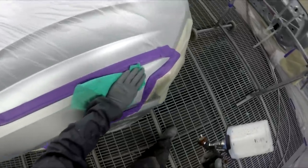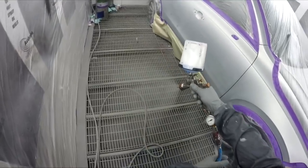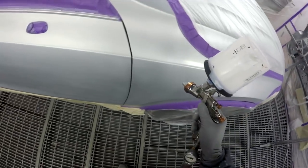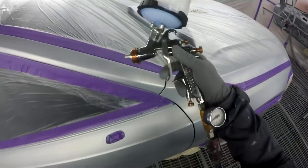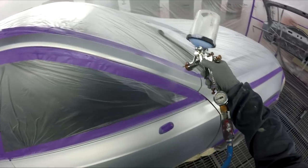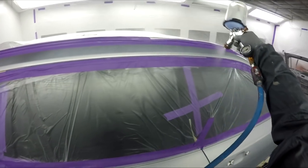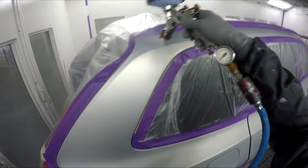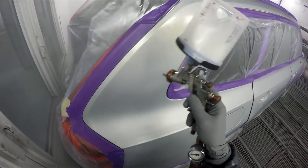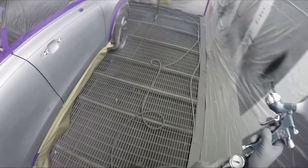So we're out to go now - I've got some slow, this is colour blender here. It's basically a clear base coat - it goes on looking all milky but it does dry fully clear. I'm only going to apply this where I don't want to put any colour, so I don't want any colour up these pillars. I've found that putting this stuff on makes it a nice clean job - for whatever reason it just makes the job really clean.